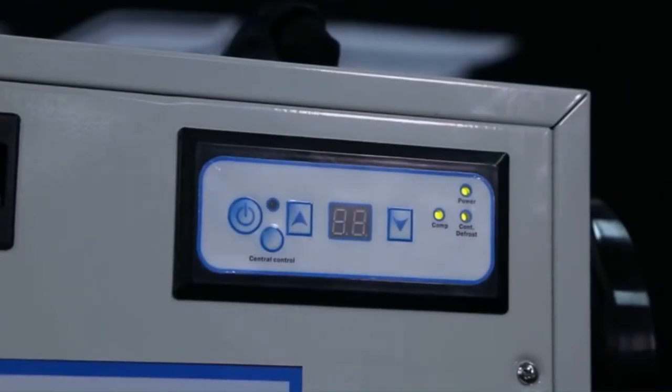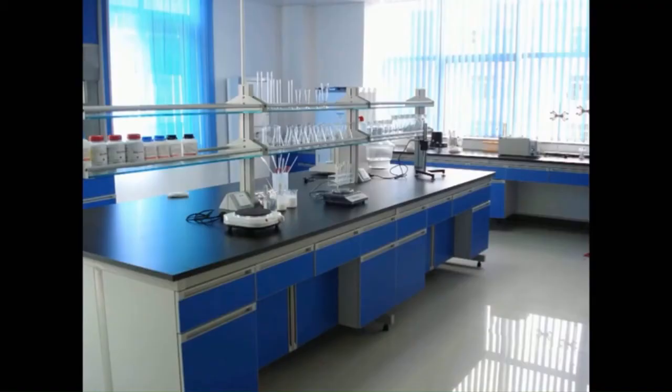Continuous operation mode is designed for special humidity level control applications. The unit starts CO mode only when the internal humidity level is at or just under 35%. It will continuously dehumidify without stopping. Some special commercial and industrial fields will require lower humidity levels for specialized applications, like some labs for biological experimentation.